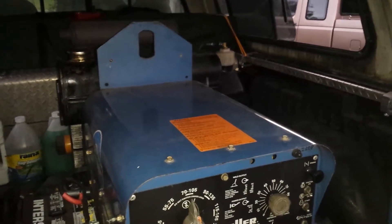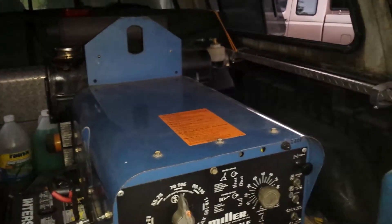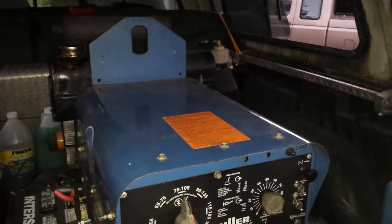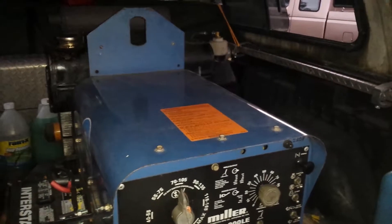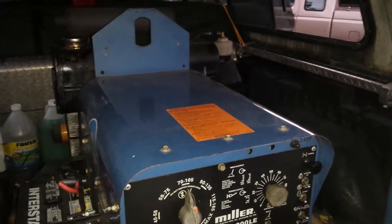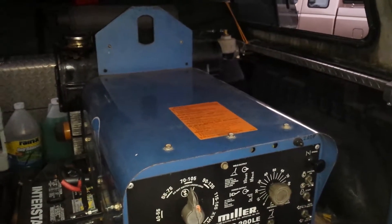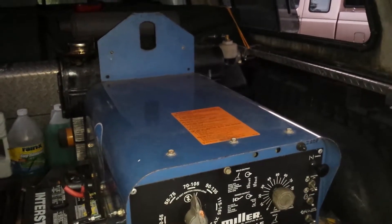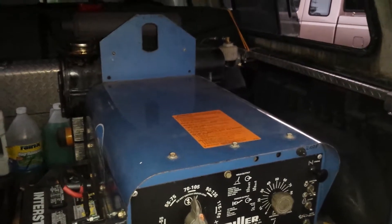At this point I'm thinking there's only so many things here. It's a battery ignition — there's the battery, the on-off switch, points and condenser, the ignition coil, and the wires. That's the system. I put in points and condenser, replaced the wires with brand new spark plug caps — good ones I've used in hundreds of applications without a problem. That didn't help it either.